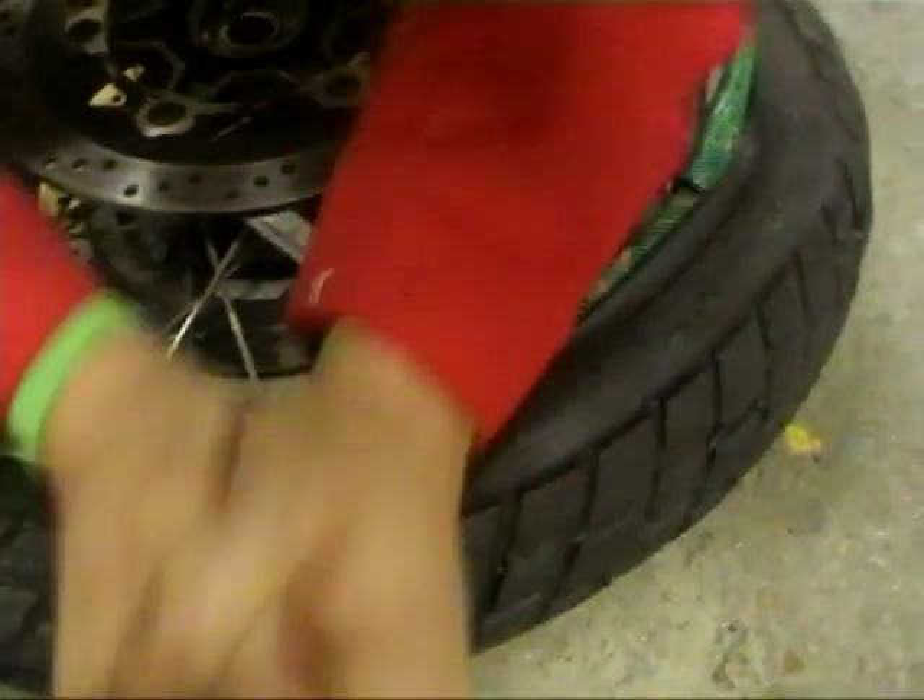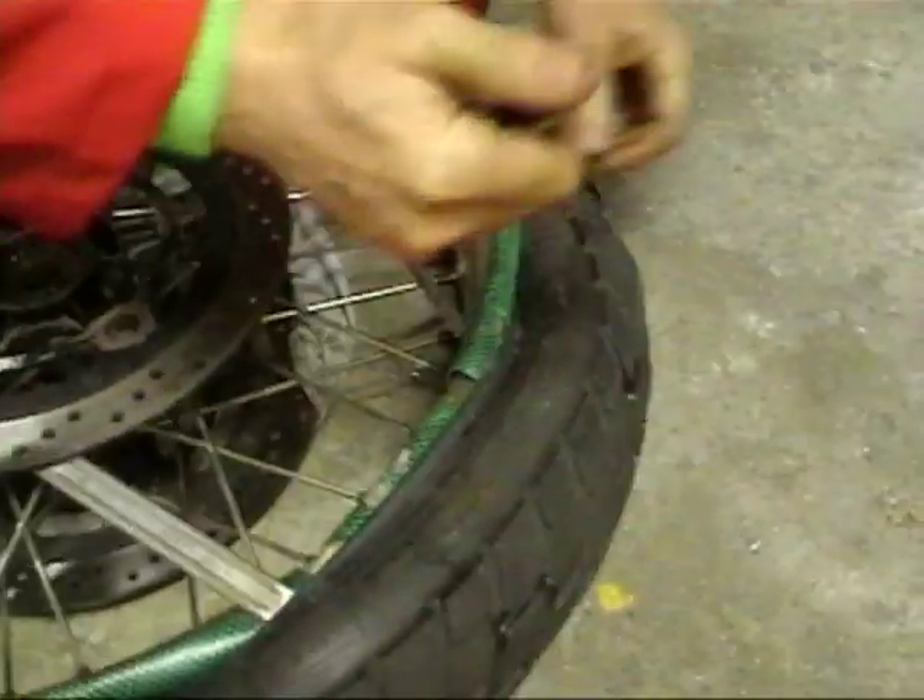Now I don't know how worried you are about the tube. Obviously if this was your own bike and you're wanting to use the tube again you want to be quite careful when putting the tire levers in, because you can easily pinch the tube — putting little holes in it. Snake bites they're commonly called. You can put a split piece of garden hose over the rim to give you a sort of pivot point for the tire lever, so you're not grinding away at the rim with the lever. There you go — that's freed up our middle tire lever.